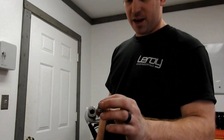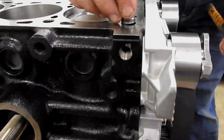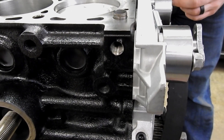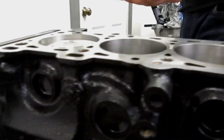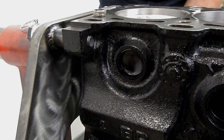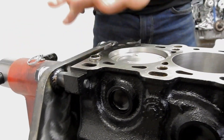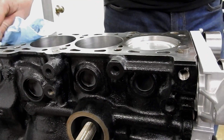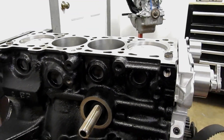We're going to put the head alignment pins in — these had to come out to resurface the block. Really easy, you drop them in and give them a little tap. You do want to press them into the block because there's actually enough room in the head for them to completely submerge themselves, and then they don't do anything. Once that's in, clean the oil off and we get to do the next fun step, which is putting the head studs in. This is where it starts to look like an actual race machine.